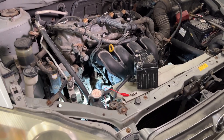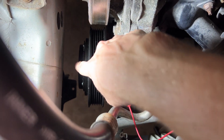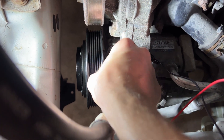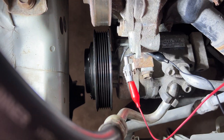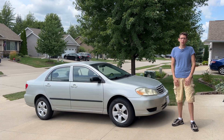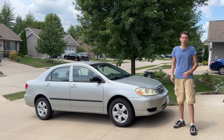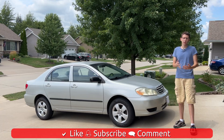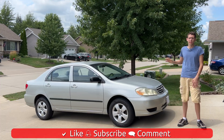Here's a demonstration of the field coil being energized using that same motorcycle battery. Right now there's no power to the field coil, so the clutch is not engaged and the pulley is spinning freely as if your AC was off. You can hear there I hooked in the power — that would be you turning the AC on. The field coil has pulled the clutch into the pulley and now when I rotate the pulley it's also rotating the compressor. Well, that's it for this video. Hopefully you learned something. It is pretty warm out, you want your AC system working, and one of the simplest things you can do at home without any fancy AC tools is replacing the field coil, pulley, and clutch on your AC compressor. So leave a comment, subscribe — we're going to be doing cruise control in the next episode of Wrenching on the Rolla, so you don't want to miss that. Give me a like, I definitely appreciate it. Get your AC working and get out there and drive. See you next time.